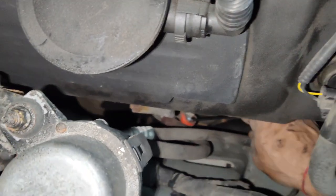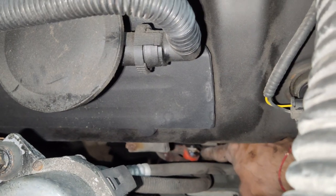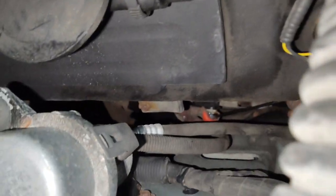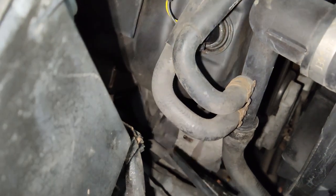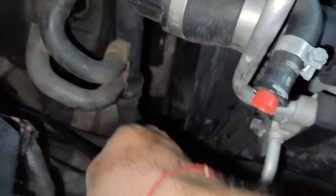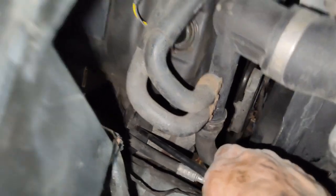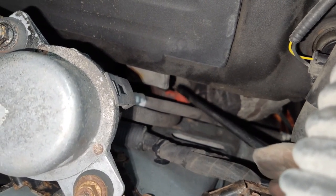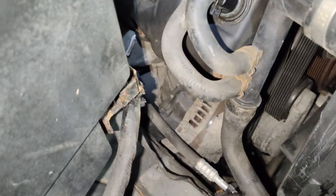For the electrical connection on the alternator — the red boot is the cover over the charge wire going to the battery. There is another electrical plug behind the alternator. The charge wire is secured with a 13mm nut on the side of the alternator. We need to remove that wire. With the charge wire removed, I was able to tilt the alternator forward — there's a plug that attaches to the back of the alternator as well. The red boot is the side wire with the 13mm nut.